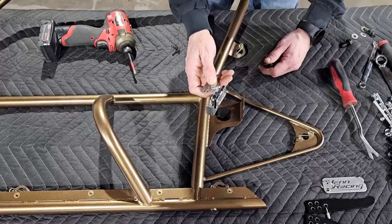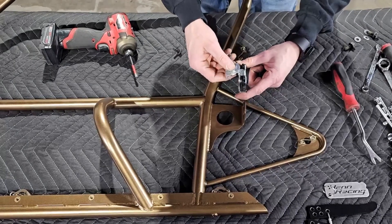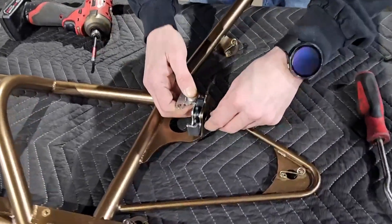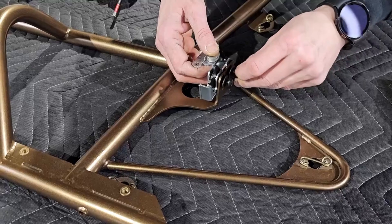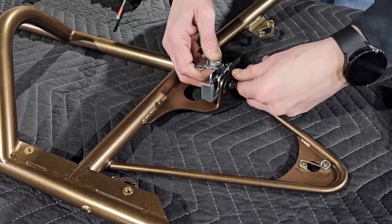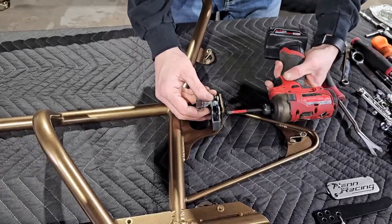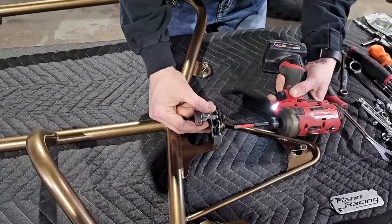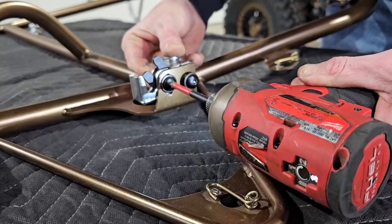So what we're going to do is install the new latch. We've already drilled this out to a quarter inch — it was a 3/16 hole. We ended up pulling out the old screws out of the other latches. So you're going to install them on the inside. You don't have to do this process right away — you can actually leave them loose and do it towards the end after you get the door swinging. I'm just doing it right now to show you on the table. Start in the middle of the slots — that's slotted right there — start in the middle just as a general rule of thumb.